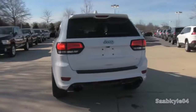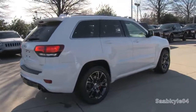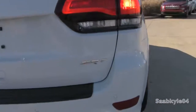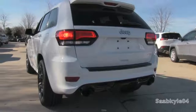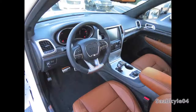That vehicle features pneumatic springs and air ride control to allow you to raise or lower the suspension as high as 11 inches of ground clearance, or lower it by 1.6 inches from its normal factory stance for easy entry and exit. There's also an aero function that lowers it automatically while traveling down the highway to limit wind resistance and improve fuel economy. The SRT8, on the other hand, features Jeep's Quadra-Trac full-time all-wheel drive system and an electronically controlled limited slip rear differential.